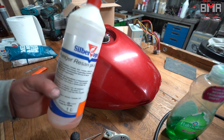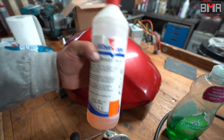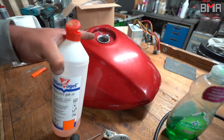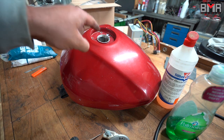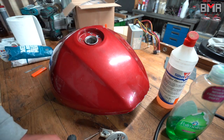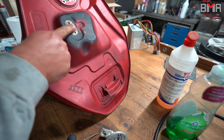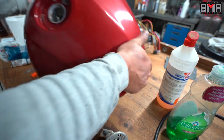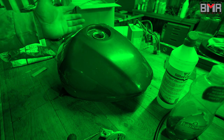Then find some kind of industrial-type bathroom cleaner used mostly in schools, hospitals, and semi-industrial areas. From that, drop inside about 200 to 400 milliliters, and then immediately add one more extra liter of water. Close back the tank and shake it like crazy — but like this, because these two holes are open where the sensor and the tap are. In this way all of your special cleaning fluid will stay inside in your tank. Shake for about five to ten minutes — it's a very good exercise.